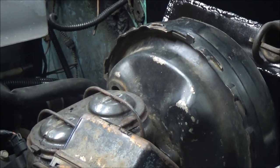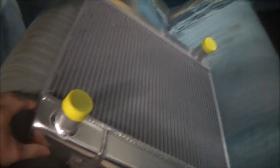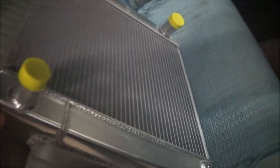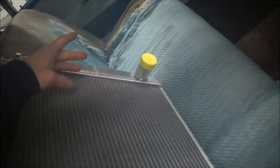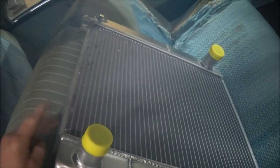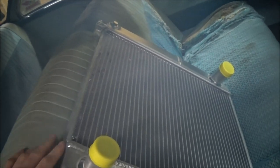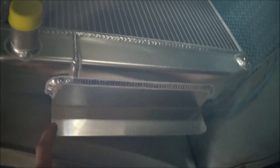This is a 1972 Chevy truck brake booster. Now here's the cool thing — I got my radiator in the mail. This is from Eastwood, it's a new design, it's a triple-pass radiator. Basically it flows across, goes down, comes back across, and goes back the other way — so it passes three times. It's also a three-core radiator. I picked that up for about 180 bucks, and it has really, really good reviews. It looks like it's going to fit just right in there — I may need to trim maybe about a half an inch off the mounting bracket. Best part: it has a port for the steam vent.